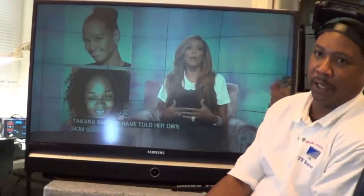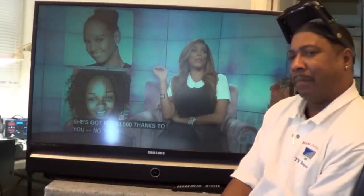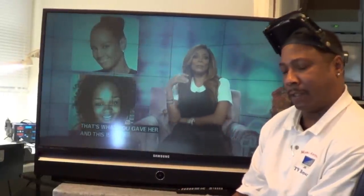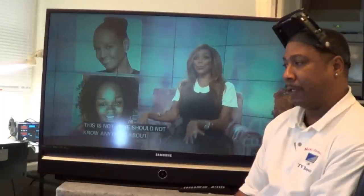A lot of newcomers to this industry are probably not too familiar with DLP TVs. Besides changing the lamp, that's really about the only thing that goes wrong with these sets. You have to change the lamp about every two to four years depending on how much you watch it. When you replace the lamp, you have to use a good quality lamp — some people buy those twenty and thirty dollar lamps online and they're not going to last long. The reason they blow out is because the actual fans inside the TV are dirty. They use a fan for the lamp, a fan for the DMD board, and may also have an intake fan.